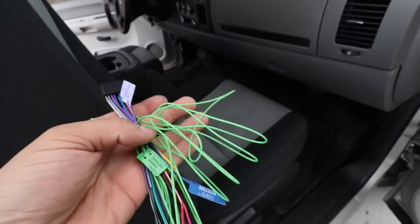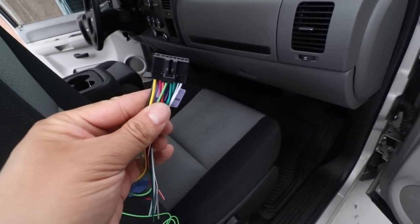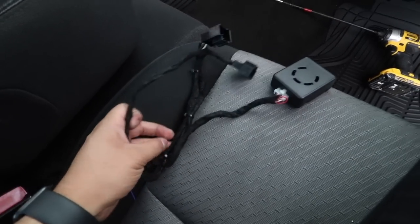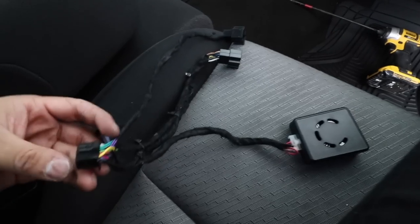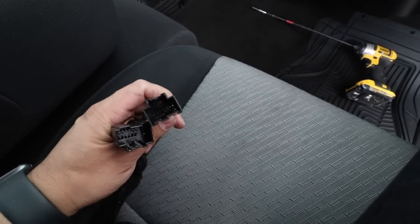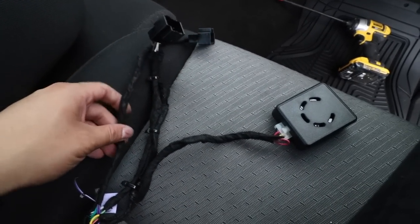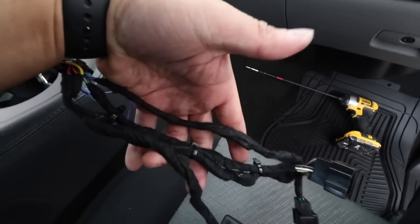In the meantime, I don't want to run to the store yet, so I'm going to be wiring our radio inside. I'll be back with all the wiring done. I finished my wiring harness — if your wiring harness doesn't look like this, you're doing it wrong. All my connections are soldered. This connection goes to the radio, this one goes to the OEM harness, and this one is to keep our warning chimes. Everything is soldered and wrapped in Tesa tape — you want to keep it nice and clean so it looks OEM, like it belongs there.